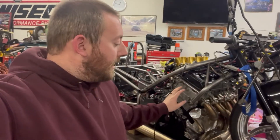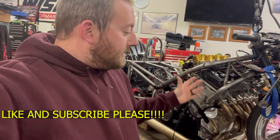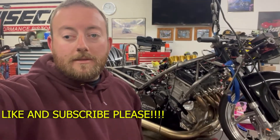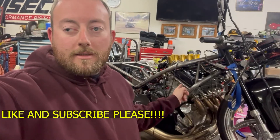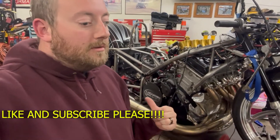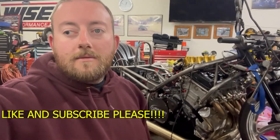The spark plug is in the combustion chamber — it's where everything happens, and that is 100% your go-to. I don't care if it's ignition timing or O2; you could even have an exhaust leak skewing your O2 reading. So check your spark plugs, check where the timing mark is on your spark plug, and check your timing on your bike. Anytime you pull the motor out of the frame rails and open it up for a refresh, when you put it back in the frame rail, start it up and put a timing light on it. Thanks guys.